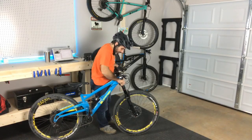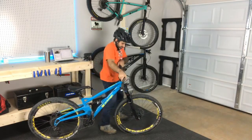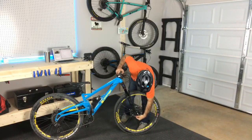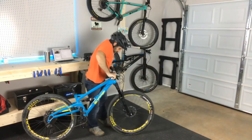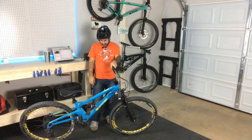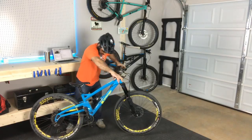Let me open it all the way up. 7 clicks for now. You know what? Let me slow it down slightly. Slow it down 3 clicks. Yeah, it feels right. Now what's my sag at?